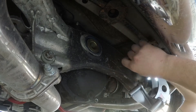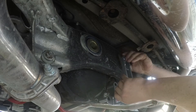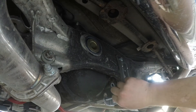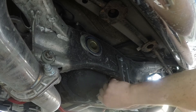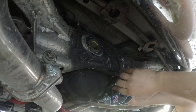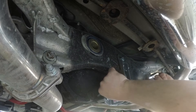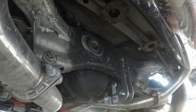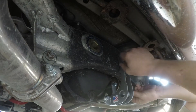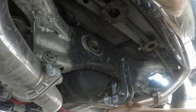Now you take your diff brace and the collet bushing — make sure it's on the bolt. It's going to go through this hole right here and it should line up. Mine's lining up pretty nicely. Do not tighten anything yet. We want to get everything threaded and put in our diff cover bolts first — there's one and then number two. Everything lined up very nicely, no issues at all. Now take the washer and nut for the top bolt and put it in on the backside.